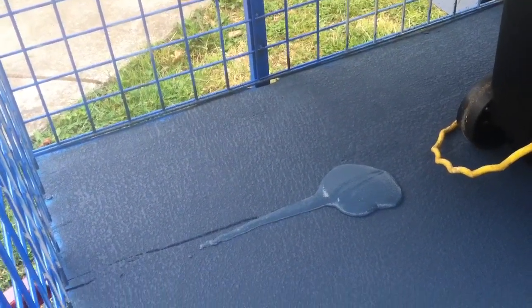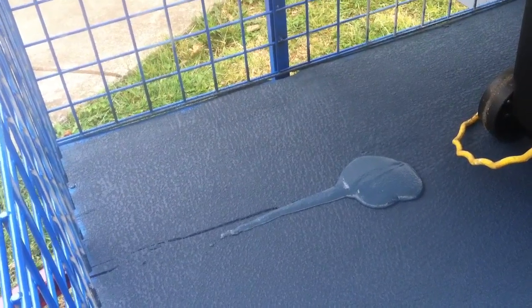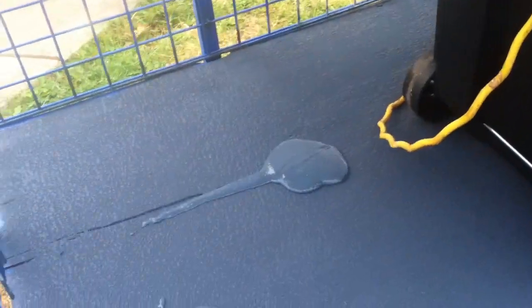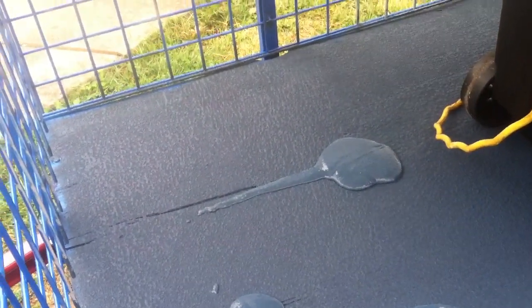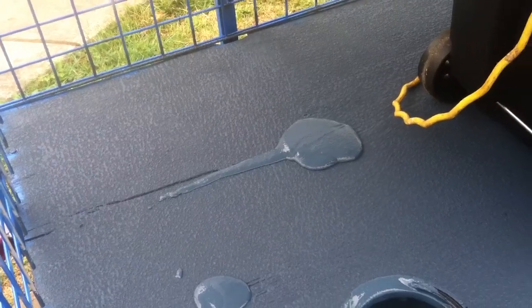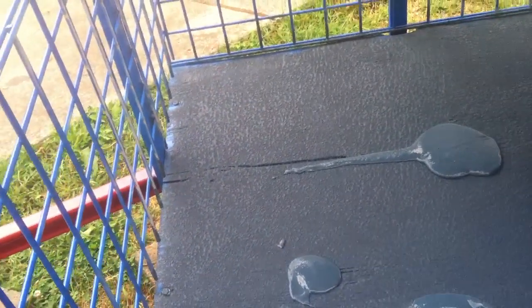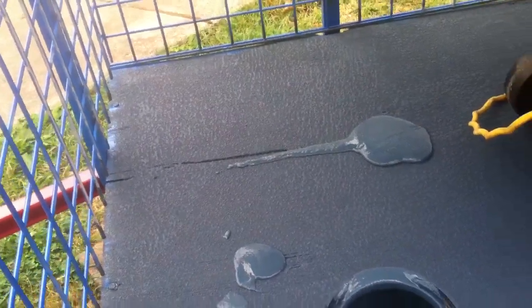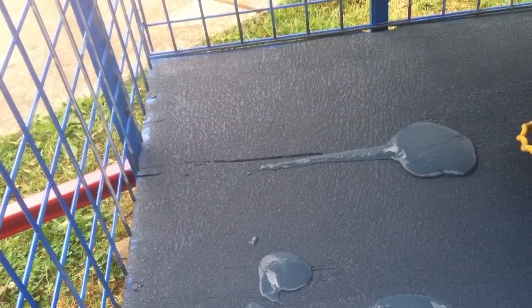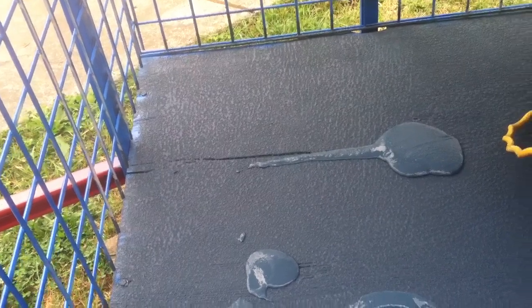Some people call it marine plywood, but it's that green, kind of funky stuff you get at Home Depot and Lowe's. That's for high moisture, outdoor type applications. And I used a fairly thick piece, so it's actually not as lightweight as some of my other trailer projects. On my last trailer project, I used a polyurethane paint, and one of the issues I ran into with that polyurethane paint was that the deck was a little slippery, okay?